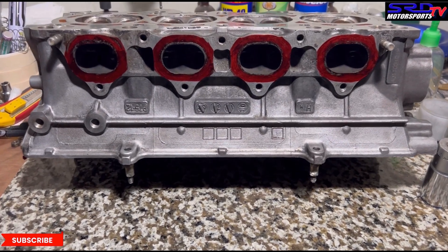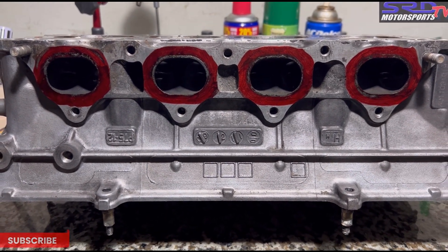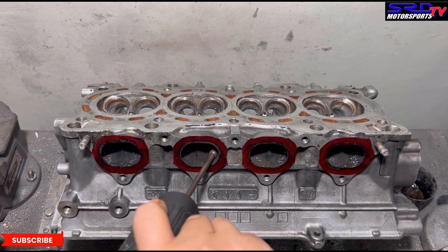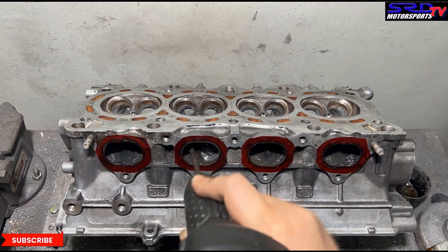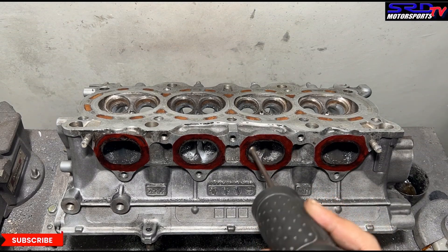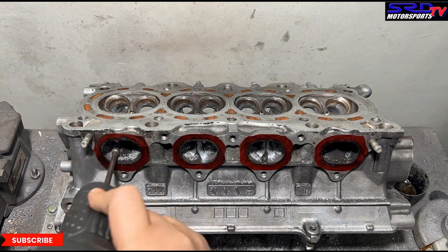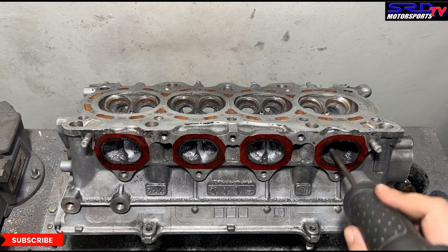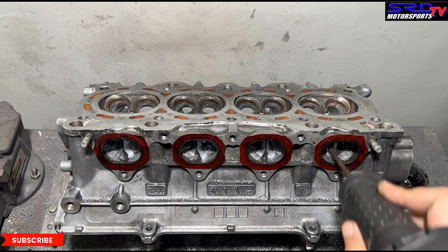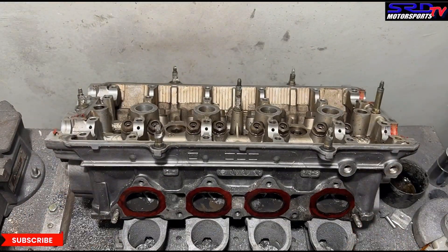Here are your stock exhaust ports, ready to get the shaping started. On the P75 CR-V non-VTEC head, the approach you take for exhaust shaping is a little different from the B-series VTEC and also the D-series VTEC single overhead cam. Each platform needs a different approach on the exhaust and the intake. We're focusing here on good scavenging, so this gets even more efficient. The more efficient it gets, the more power it can create and the better fuel consumption you achieve — because gas prices are pretty high.